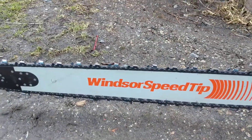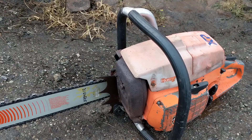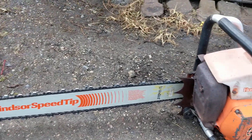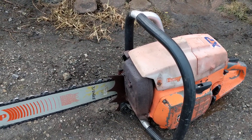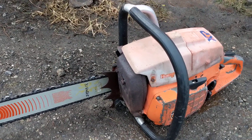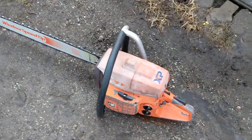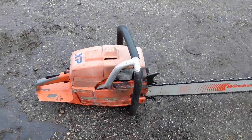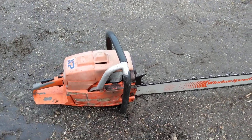The chain continues to move while the saw is at idle. It also runs a little bit rich — you could hear it when I revved it out. But generally on these larger saws you want to run them a little rich because they get buried into some deep wood and work pretty hard. I have no large trees to cut down with this thing, so I'm going to set the carb up a little better and clean her up and put her up for sale. Well, thanks for watching.